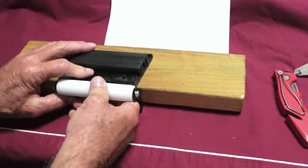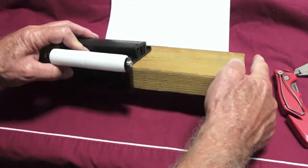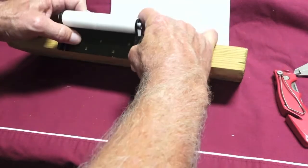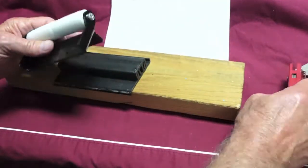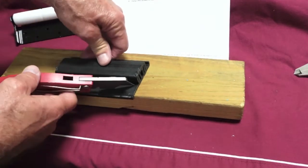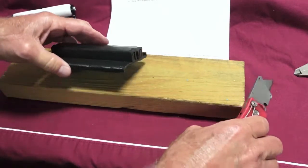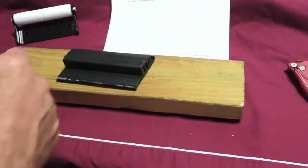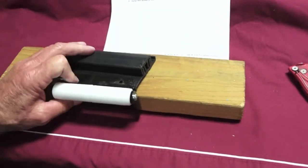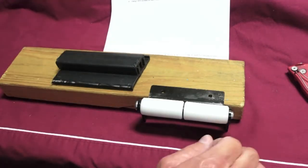And the way we're putting them on, it's going to be slightly higher, about 1/16 of an inch higher. And there's no getting away from that, because to really assist with the wear bar, this needs to be removed. This guy right here needs to come off, and you're not going to get him out. So the next best thing is to put him on top and screw it down. Depends on your application. Now this is only for BAL Accu-Slide.